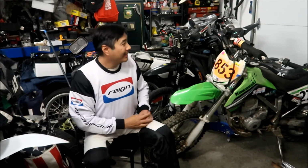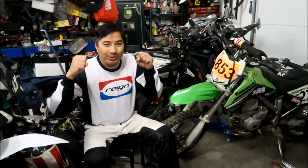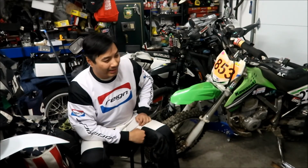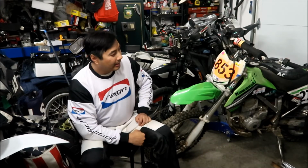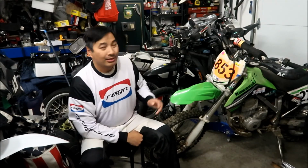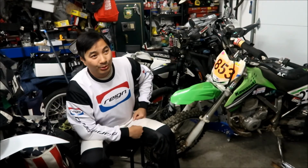At the beginning of the race, I think I had the crank buster turned up a little too much, and the bike would just take off by itself sometimes. Yeah, it was kind of scary, man. And the front would just kind of plow into stuff. Like I said, I could probably fix that by moving the forks down into the fork tubes. But for supermoto, it works great.